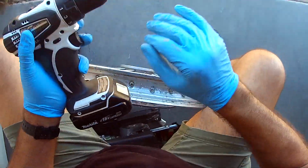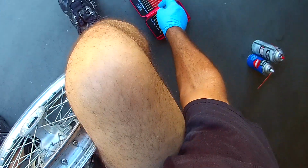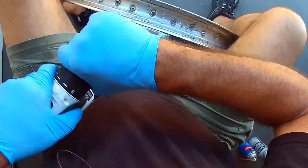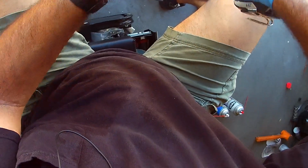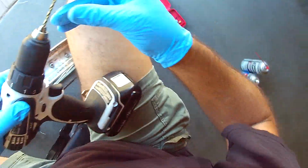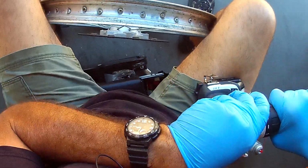Okay, and I do have my safety glasses on. So, all right, and that was a 7/64. All right, so now let's just go 5/32. We'll just go up gradually. Okay. Yeah, once you get the first one, it goes pretty darn quick. And we'll go up 7/32. Doesn't really matter, it's just you're going up a little bit at a time.